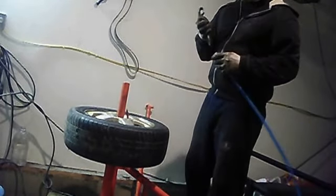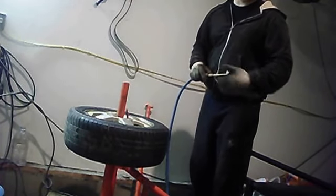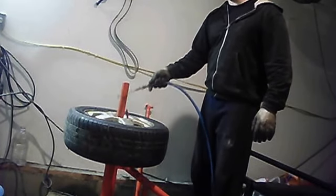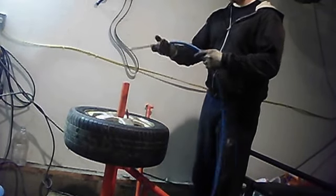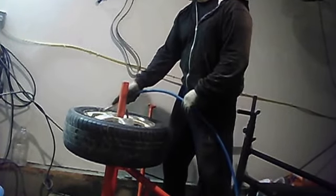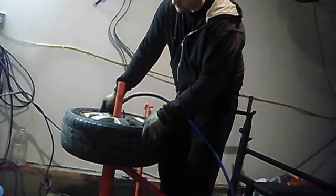That impact, it's like a 600-pound impact. Usually most even smaller air compressors will run impact fine if you're just doing short bursts. But you want enough air pressure to seat this bead. So if you have a tiny air compressor that really can't put out much air, sometimes you won't be able to seat the bead. And then you want to use 3/8 hose, not 1/4 inch hose. Go ahead and fill your tire up. You can see it's holding air just fine.